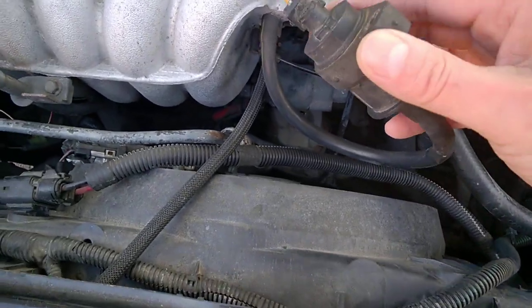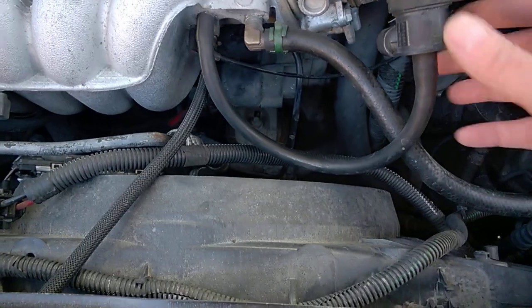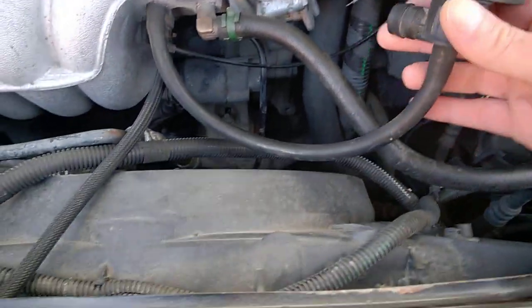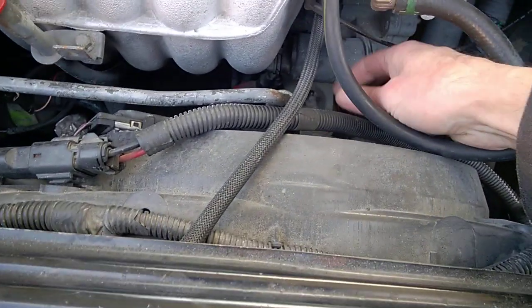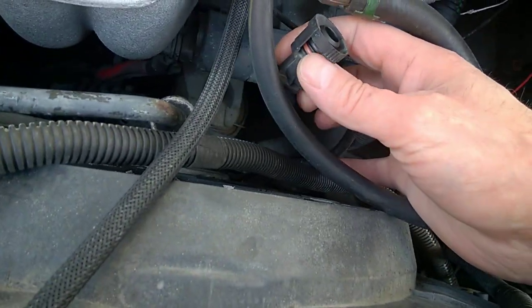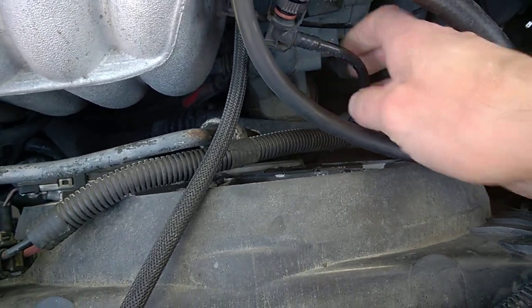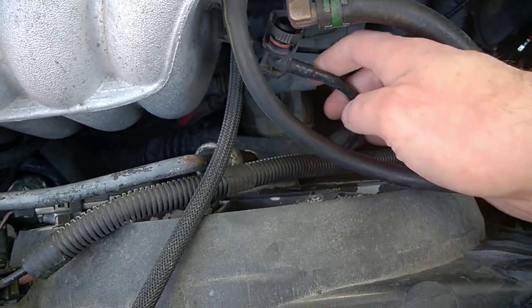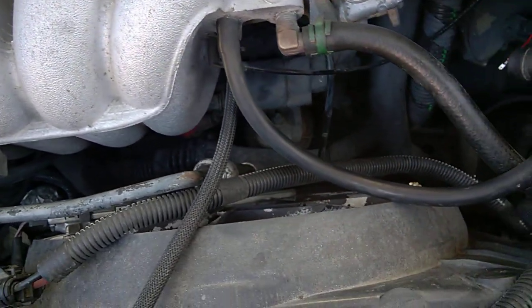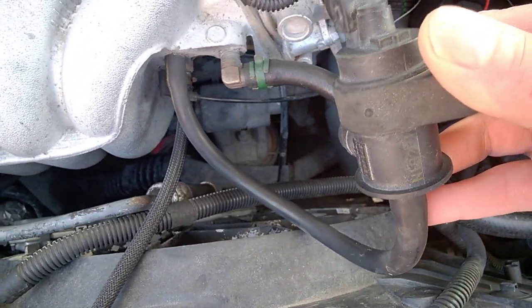Now this guy, it's a little bit tricky to undo. You see the hoses coming from the intake. There's also a tube. This guy here — just depress the side — it has an O-ring. This one comes from somewhere near the gas tank and is bringing gas vapors to be recirculated inside the engine.